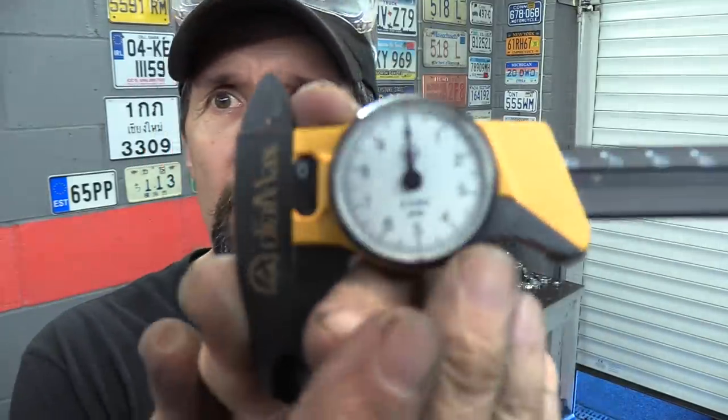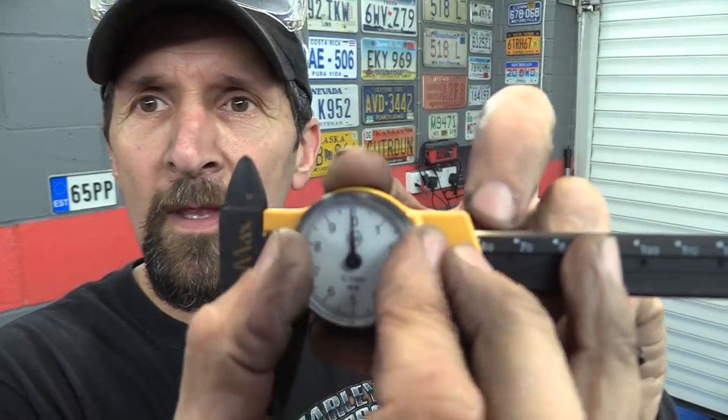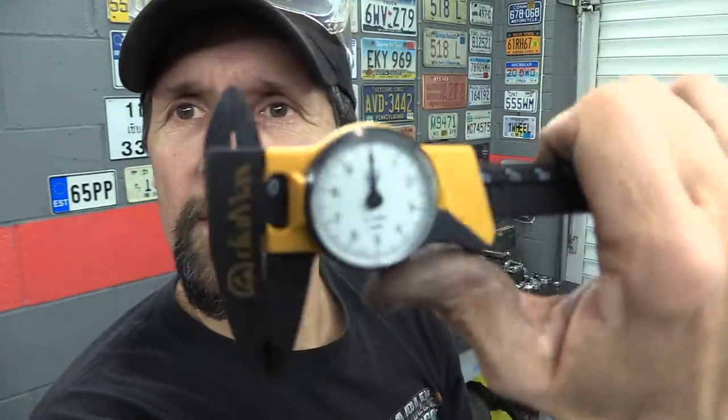So let's measure my bar clamp and see if it still comes to 28.07, I think it was. You zero these by coming in on the dial, and you can turn the dial by hand like that. Let me just do it, hang on. There you are. You just close it up, turn the dial, and that sets it accurately wherever it is. That's also good for if it's open and you then want to zero it to measure the difference between something, you can zero it at any point. But bringing that in to zero, there it is, absolutely bang on. Okay, there it is on zero.